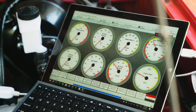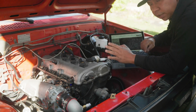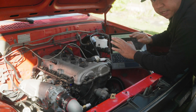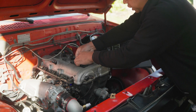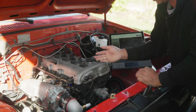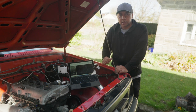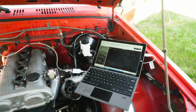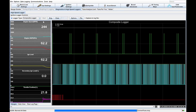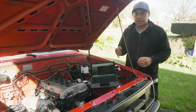Go into Diagnostic > High Speed Logger, then click on Composite Logger and hit start. Since we're only checking the crank and cam sensors, unplug everything else so the engine won't start — we're just verifying the signal. Unplug your ignition and pull the injector fuse. Now crank the engine a few times; you should see a reading across the board confirming the sensors are working and ready to fire. Those readings confirm we have signal on both crank and cam.